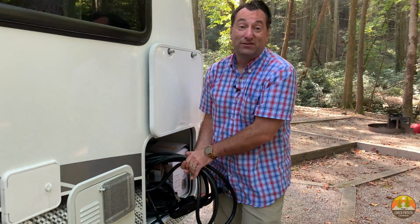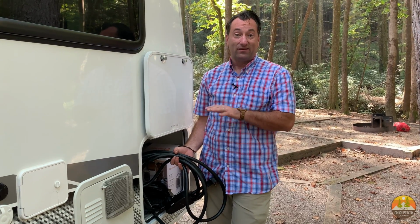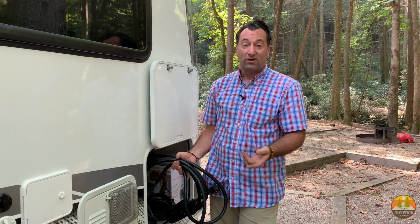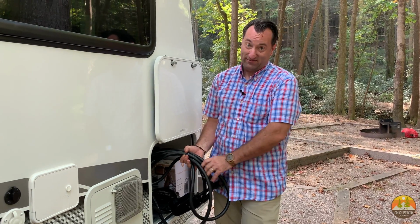Okay, the next thing that I do depends on you and your personal preference. Once I get the trailer locked down, leveled, and stabilized, you can either do your electric connection to shore power if your site has it, or you can do your water connection or your sewer connection, depending on your site and what type of hookups you have.